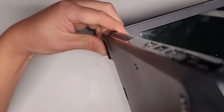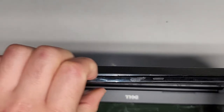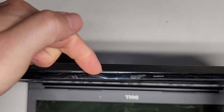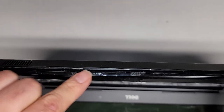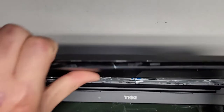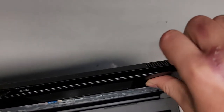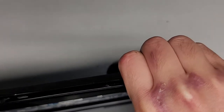I actually hold from both sides like this. Let's see if the bottom pops out or if we have to pop it out from the top. It pops out from the bottom side — you get between the base cover and the front side of the palm rest assembly. You don't want to push on the track pad, so we're only pushing here. You can use pry tools if you want, but I find using fingernails is easiest.